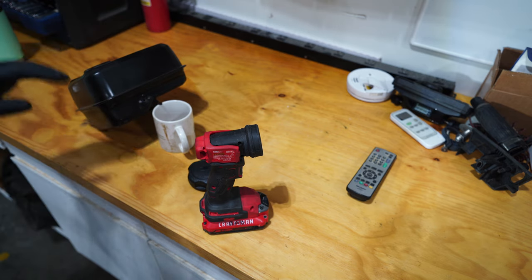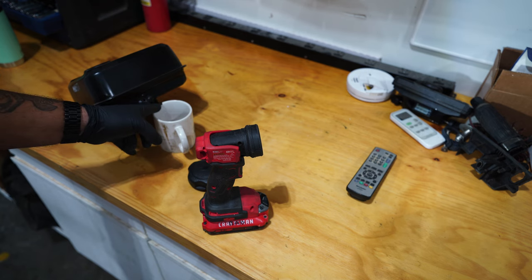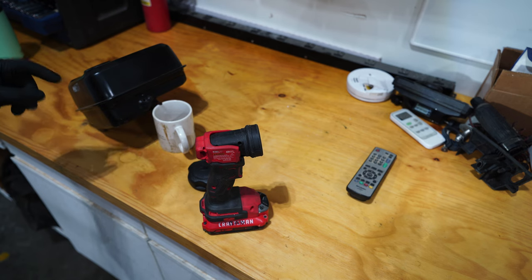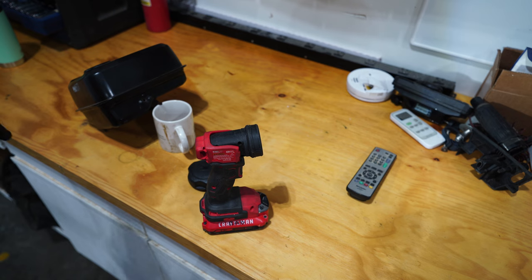So I think since there's so much rust in the bottom of it and there's a little teeny bit of old fuel that I just can't get out, I think there's a little filter screen on the inside of the tank, on the other side of this barb. I think that's clogged up with rust and gunk. I have some rust dissolver. I'm going to pour it in there, just let that soak for a while, and then work on trying to get as much of the chunks and the actual rust out of there as I can.